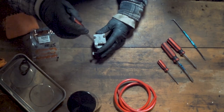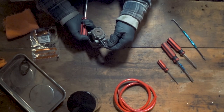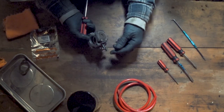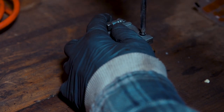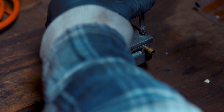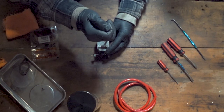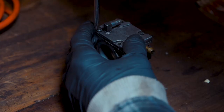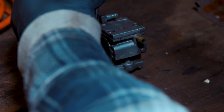So it doesn't really matter where you start — just remember where things came from. I'm going to start on this face here with the Walbro logo. These will be done up fairly tight; make sure you're not leaning on any of these pins, which are high and low — I'm going to be tuning this carb at some point so it doesn't really matter how I move these at the moment. Make sure it's on a solid surface, put some pressure down in there, then just turn — that way you're not going to strip any screws out. Make sure you collect all your screws so you don't lose any — that's what your magnetic tray is for. It looks like they've all got a little washer on them as well, so make sure the washers go back on when you put this back together.